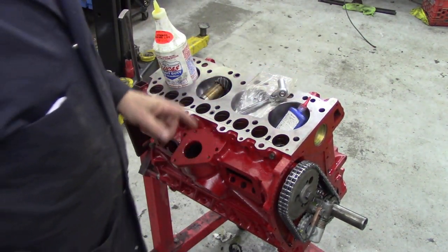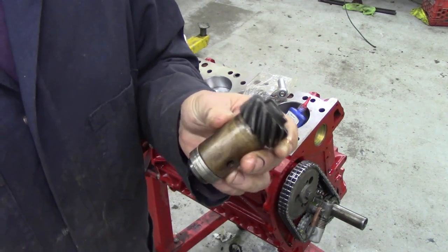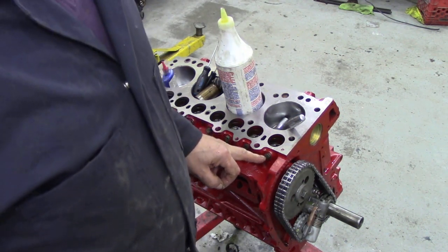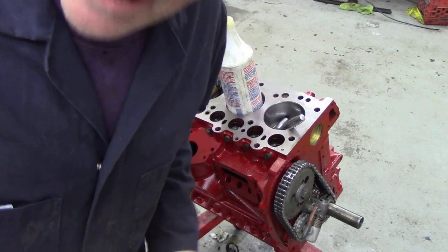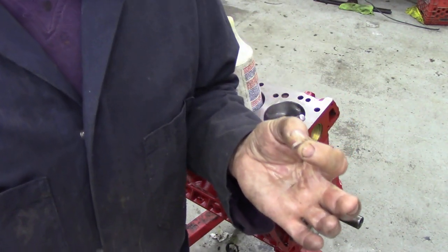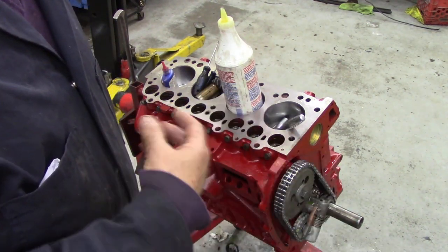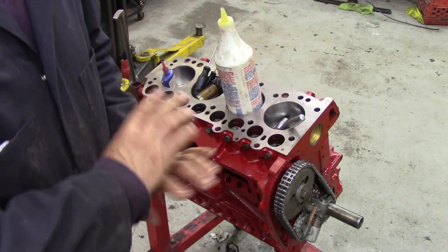So I'm going to get on with these and then we'll come to the exciting bit — this helix drive for the distributor drive. Now, I might have made a schoolboy error — when I fitted this bolt here it didn't have a washer on it. Well, apparently when I fitted all the rest they had washers — a little aluminium washer. There were only three in the packet and I think that's what threw me. So I've used the old ones again with some thread lock on — the thread lock will act as a seal to stop oil getting through. They've all now got washers on, they're all tightened down. That section is finished.